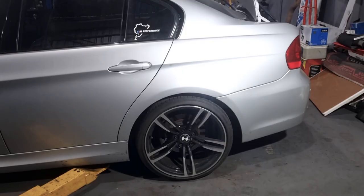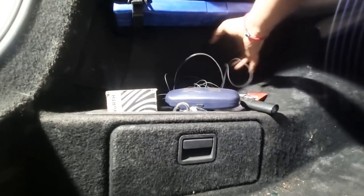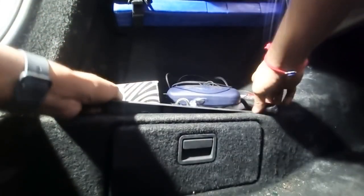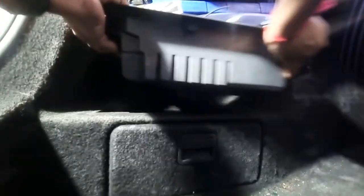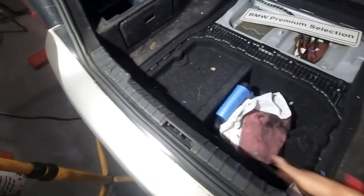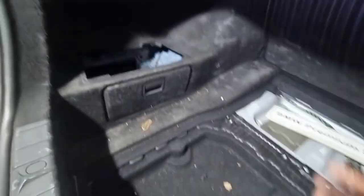It's about time to get the shocks ready — it's been bugging me for a while. I'll be leaving all the information down in the description below. Let's get into this. Starting off by removing the storage tray and storage bin — all you have to do is lift it up and slide it out. Now that we've got that done, it's all a matter of the clips all around. Remove this plastic cover so you can get this out, then the carpet should come out freely after we remove all the clips.